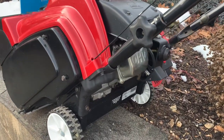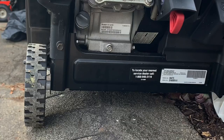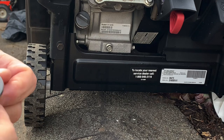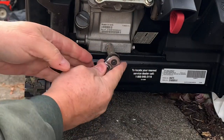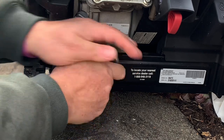So I just warmed it up and I'm going to change the oil. Let me shut it off so I can get this oil draining out. This thing has a 10-millimeter screw for the oil. It takes roughly 12 ounces of oil. So I'm going to use a little Chinese food container. Righty-tighty — lefty loosey!